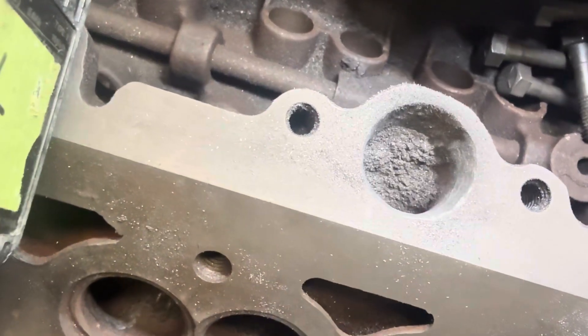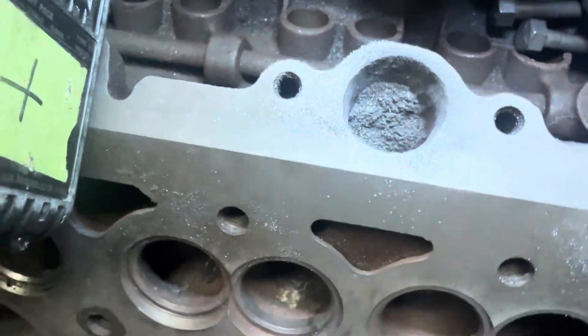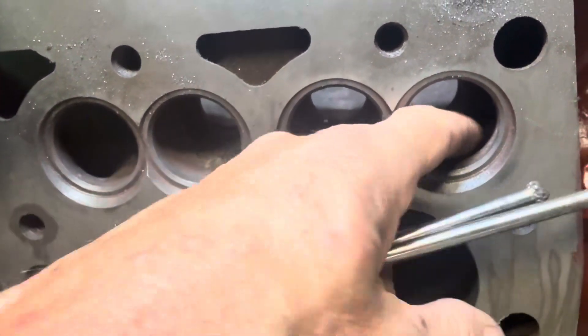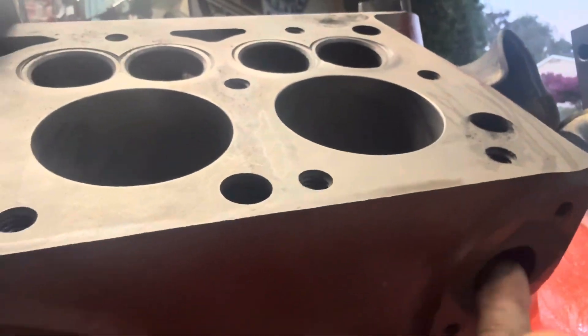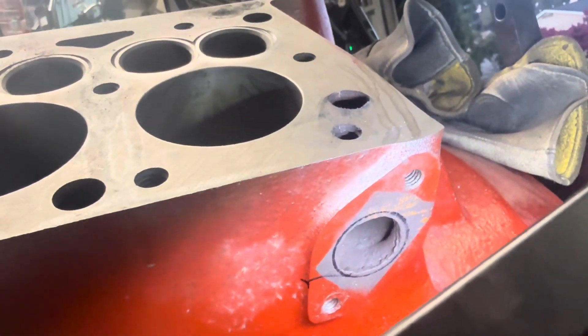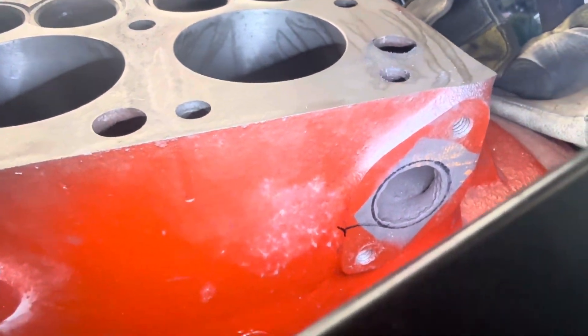It takes a little time - I'm not done by any means. I'm going to raise the ports here just a little, and the main thing is just opening up these bowls - blend and just take any sharp lines out of here. What's huge on this thing and the flatheads is you've got to take out this big square corner right there, gasket match it, just kind of smooth this out a little bit so it goes out the port. Those are huge improvements.